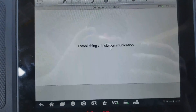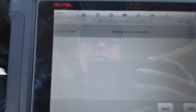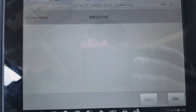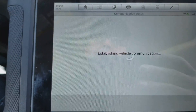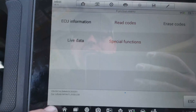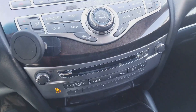Select initialize image camera calibration, hit yes, and start. It's going to take a minute. Once it's done — no fault codes. That simple. Go back into the park assist now.